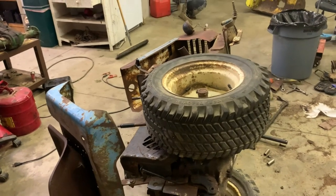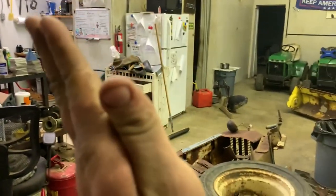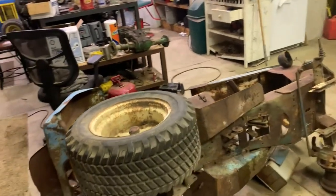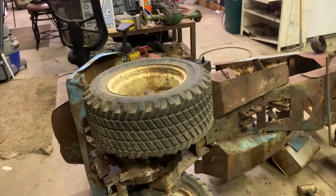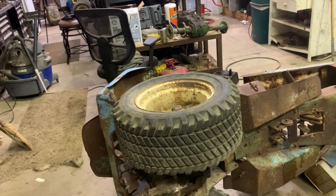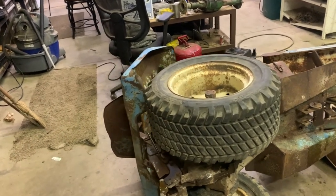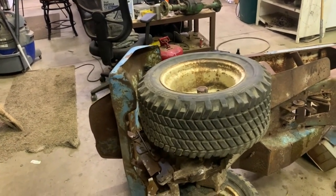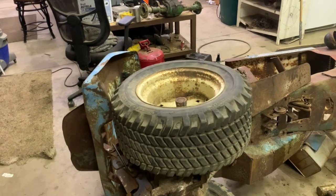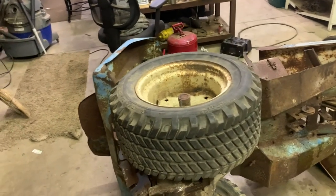Like I said, though, the top of it pumps fluid, and then there's a swash plate that goes like that or like that, depending which way it goes, what makes it pump fluid down to the bottom section of the pump. And there's a set swash plate down there where the one up top moves. The set swash plate down there is how much the pistons go in and come out of their bores. And that is what makes the tractor move. I know that probably wasn't the best description of it, but that's probably the best explanation I'm going to be able to give.